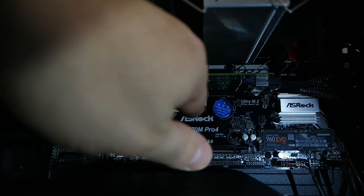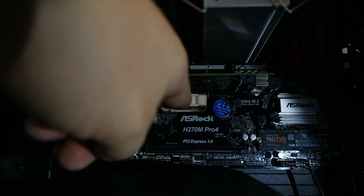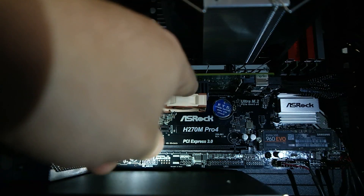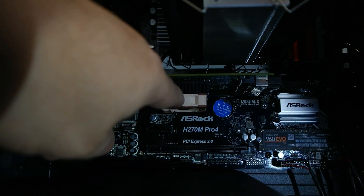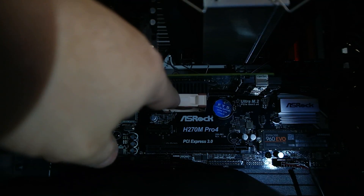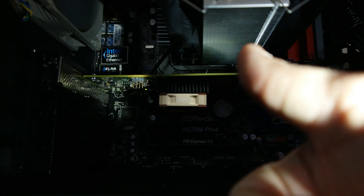This thing is very quiet — I can't even really hear it over the rest of the fans going on in here. One mention of caution though: make sure you plug this into a 4-pin header on your motherboard and have hardware monitoring in case the fan ever goes bad. Don't cheap out on these fans — cheap 40mm fans are definitely known to go bad really quick. Get a quality 40mm fan; it doesn't have to be a Noctua, but get a quality one so you get years of service out of it without having to worry about it.